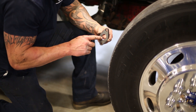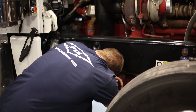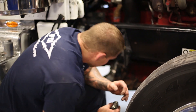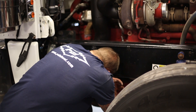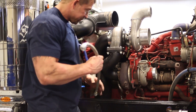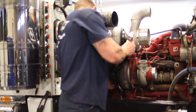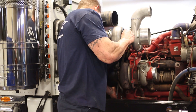This is the new flange for the oil drain — it's an o-ring seal, so make sure the o-ring sits to the outside, and it's a JIC fitting on the other end. Just twist it in by hand and then finish tightening once the tube is on. Our drain tube has a 45-degree fitting at one end that goes to the top, and you have to form it around going behind the doser valve down to the new block.